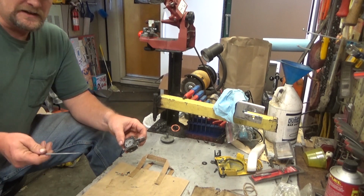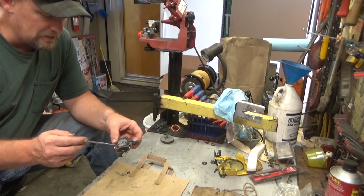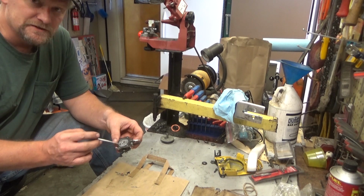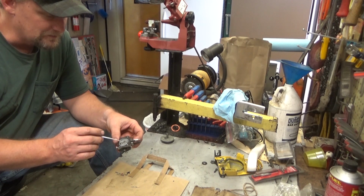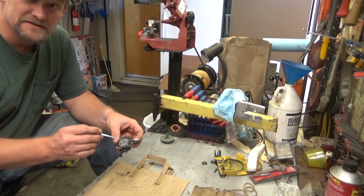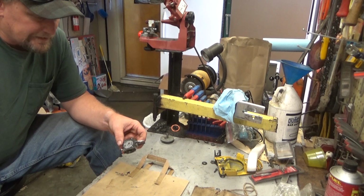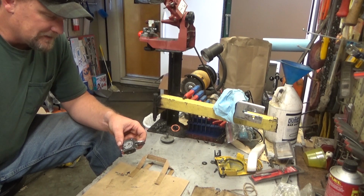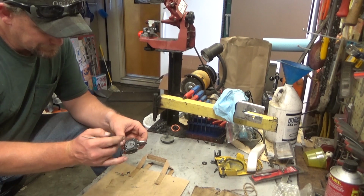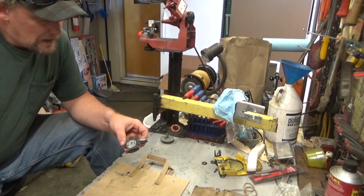So like I say, the K10 HDC kits that are out there include that snap ring, they include that screen, they don't include the check valve itself or this body. You've got to get a separate kit. Now they are still available from Walbro, but they're getting harder to get, and they're quite expensive. They're over 10 bucks a whammy for that little stupid thing right there.